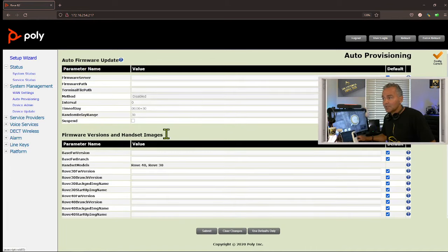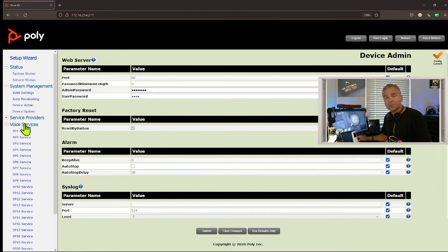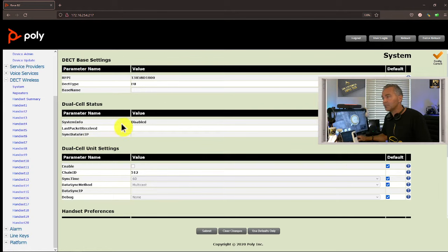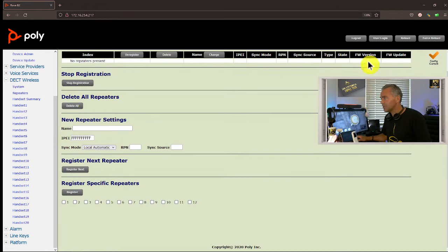System management, here we'll find some information on the provisioning. I will show you how to upgrade the devices, the B2, the handsets, the repeaters, etc. I will show you that in the next video. If you need to change admin passwords, etc., that's also a possibility, of course. Hook it up to the different voice providers. DECT wireless, here you will find the information on the different DECT devices. As you see right here, the repeaters, if there is any software version, it'll show it also right there.